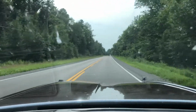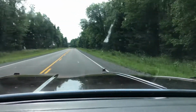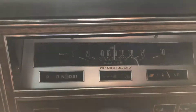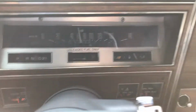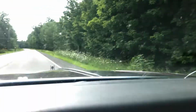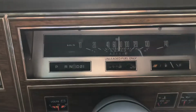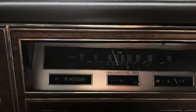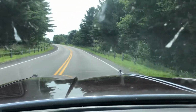But we can tell with the exhaust leak, I just rolled up the windows. At 50 miles an hour, it's good. But if I let off and bring the car down to a speed of about 45, let's say 40, the transmission always goes into fourth gear too early. There's fourth with it locked up. If you can hear the exhaust, I think it's coming from that side. I'll bring the car back down to 40 miles an hour again. Well, let's do even better. We'll bring it down to 30 miles an hour. Lugging the engine. So with it engaged all the time, that's no good.